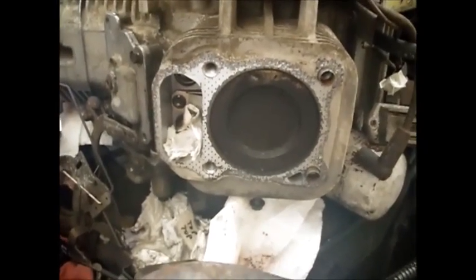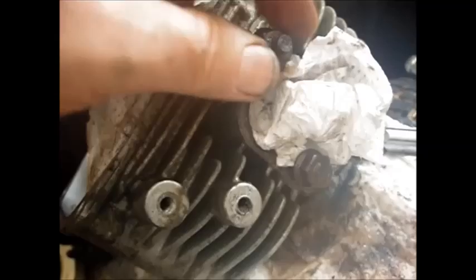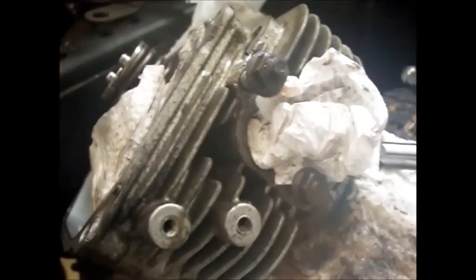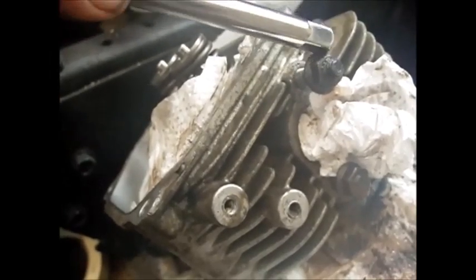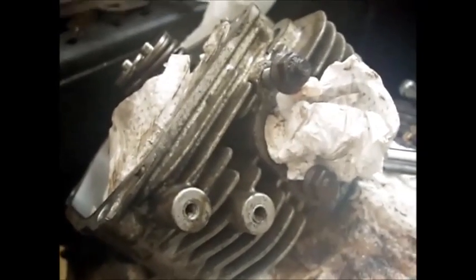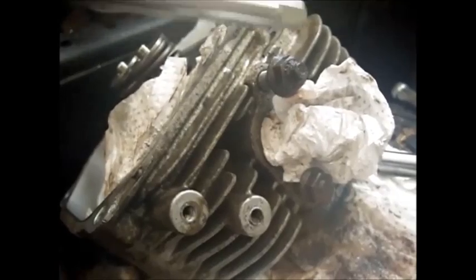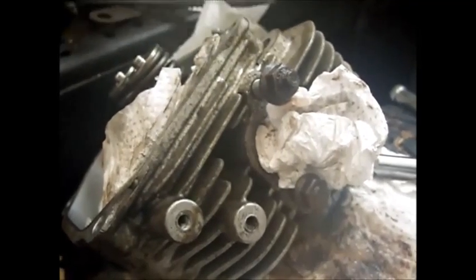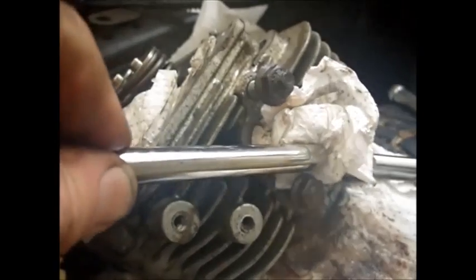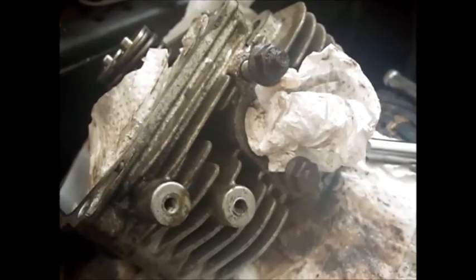I'm going to replace that gasket on this side. I don't really like pulling a stud out of an aluminum thing like that - after years of working on motorcycles and boats, they never seem to tighten down right again. I might soak this up with PB Blaster overnight, then try to grab it behind here on the blank spot where there's no threads with a vise grip and see if I can force that nut off. If I can, I'll reseat it with Loctite into that head. If not, I'll just screw it back in with Loctite or gray RTV.